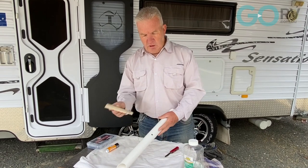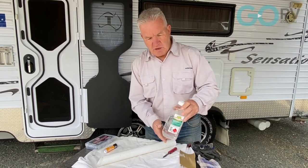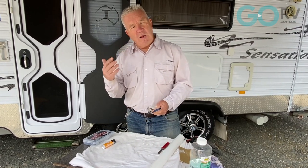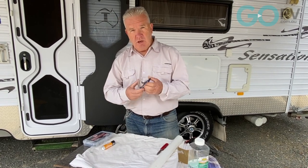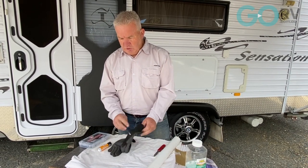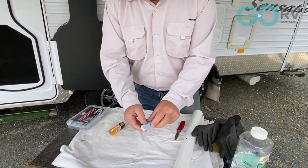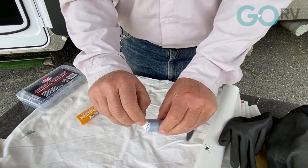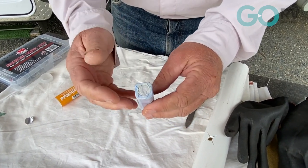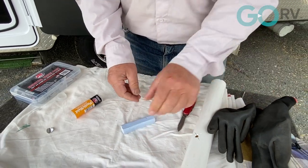You do need to prepare it first. I've already hit it with some sandpaper to rough it up so we've got something to adhere to, and I've cleaned it down with a bit of methylated spirit so it's clean and ready to go. You should be wearing some PPE - mainly when you finish it and you're going to sand it, you don't want to get that stuff in your eyes, so you'd need glasses. For putting the putty on it's not so necessary. Now let's get the putty out. There it is - it's wrapped in some outer sheathing with a cover on the front. I'll take that cover off and you can see this is where it's the two-pack part of it - we've got the main product and then we've got the hardener.